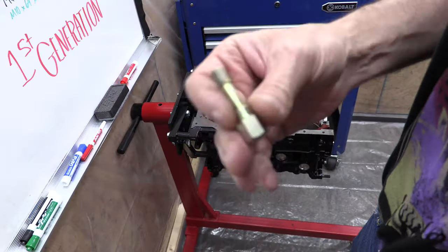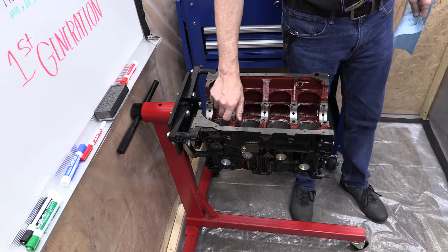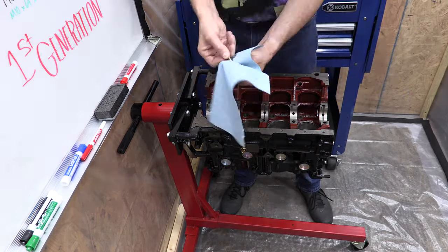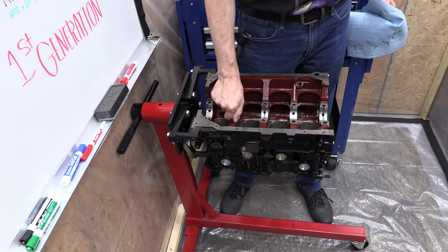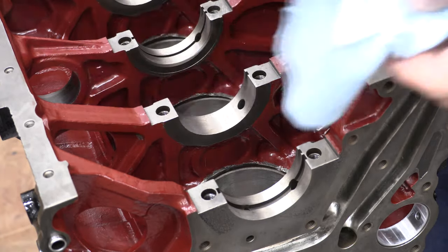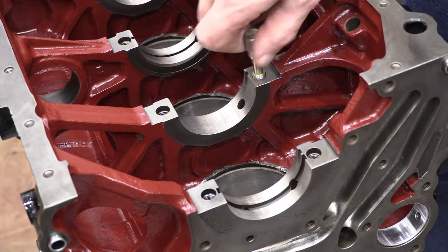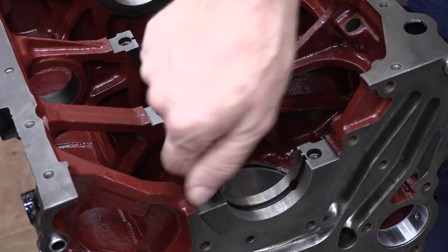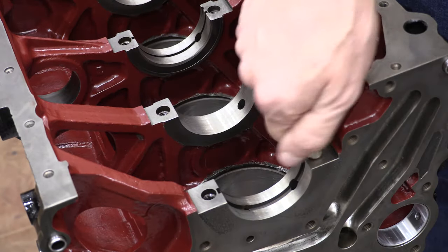You didn't see me chase the mains in the last video. I made some stupid claim because of a parts mix-up on my shelves that was completely inaccurate. I said that DSMs had 11mm main studs, but I guess what I really meant to say was that I had put my used 2G head studs into an old 6-bolt ARP main box, and I measured the wrong parts from the wrong box when I did my voiceover. They are indeed M10 by 1.25mm threads. All 4G63 mains are M10.